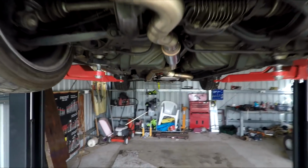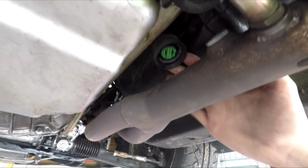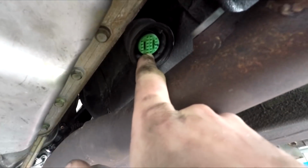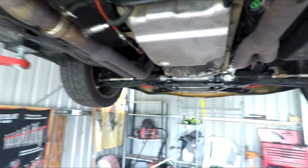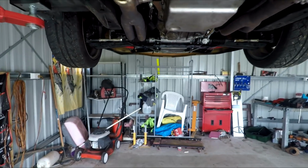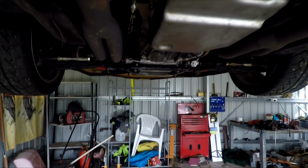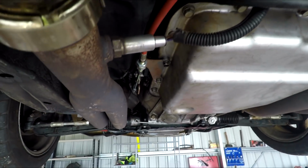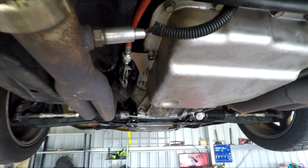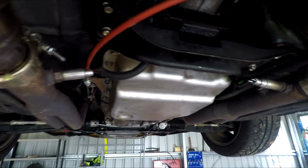Okie dokie. We have taken the connector out of the gearbox, which was quite a pain in the ass. Here's the connector, and we found the power, which is the lower right pin here, pin E. We continuity checked that to the remaining wires we have left in the car, which was a pink and brown wire. We still got another pink wire, pink and blue it was, sorry. We still got another solid pink wire. We don't actually know what it's for yet, so we're going to continue to check all the wires on the range sensor, because I've still got a range sensor fault as well. Once we do that, we can wire it all up, and fingers crossed we get gears. So I'm glad we got that.